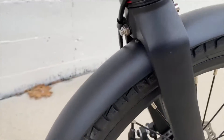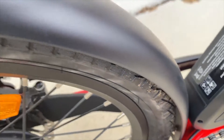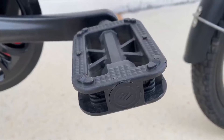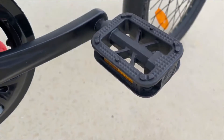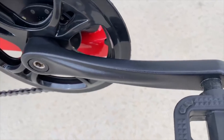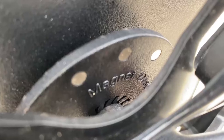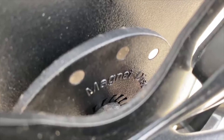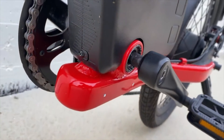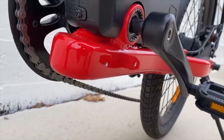Wheels are 20-inch double wall alloy rims with Kenda Contact 20x1.95 street tires. Both wheels are wrapped with aluminum fenders front and rear, and fortunately they're factory installed. These are folding handlebars but no folding pedals — plastic flats, lightweight, we'll see how they hold up. The alloy crank arms are 170 millimeters, and the entire crankset is Pro Wheel with a single 44-tooth chainring, with a magnet disc cadence sensor sandwiched in there. To go along with this unique frame style, there's an elevated bottom bracket on top of this bottom pill-frame section.